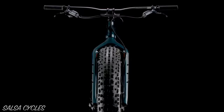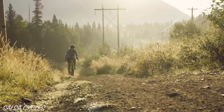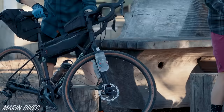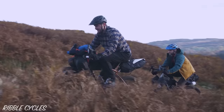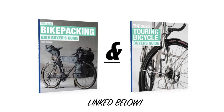Which bike should you use? To reiterate, you can use any bike for touring and bikepacking. But if you want to optimize your setup, you should consider your total load, the surfaces you will ride, the steepness of the terrain, the bag setup you prefer, and whether you will have access to spare parts or workshops with the appropriate tools. A decent bikepacking-touring hybrid is an off-road bike that's overbuilt, has generous tyre clearances, and mounts for racks, fenders, and cargo cage bags. If you like my videos, you can support them by getting a copy of my books, joining my Patreon where I offer rewards, or by liking and subscribing.